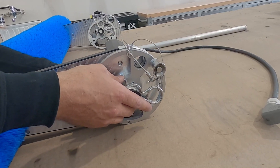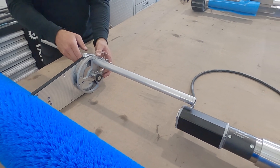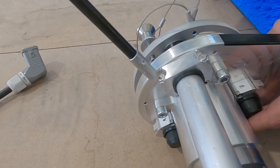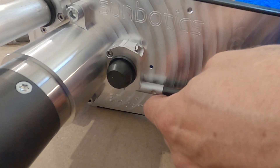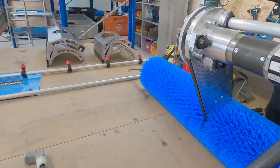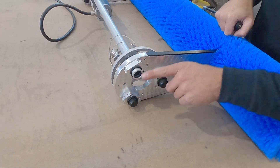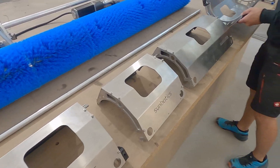Afterwards, attach the two suspension adapters. It is vital that you only fasten the quick release of the base pipe and not the two black pins. Make sure that the synthetic clips of the two splash guard sheets are positioned on the outside.